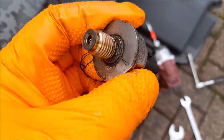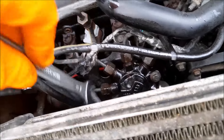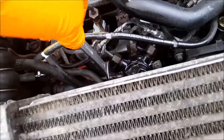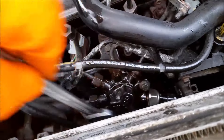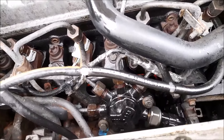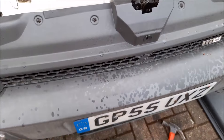There's the old one, there's the old one there - new one is obviously installed. What I did is I got my 17mm spanner, with the engine running all shitty and cracky, I just cracked that off very slightly until I got a bit of spit at that one. Number one and number four killed the engine, so I just nipped it back up, started the engine again, and carried on around until that one, and then that killed the engine as well. So undo it a little bit, let your diesel purge any air in the system, because when you change this switch, obviously a little bit of air has gotten into that system that directs the fuel to each cylinder via the pipes. Bleed out your air.